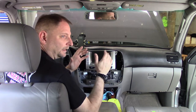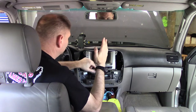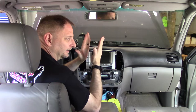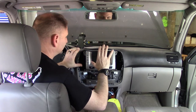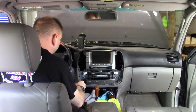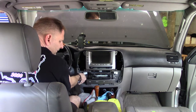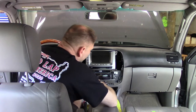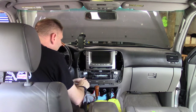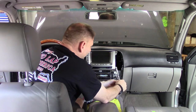You'll bend it if there's too much pressure with the wire harnesses, you'll end up bending these tabs, these ears, these flanges. It won't pull the whole thing in, it'll just bend in. That's why you want to make sure it's as flush as possible before you ever start putting fasteners in. And you just put our fasteners in, they're 10 millimeter. And the torque on these is snug. We'll just go back over these. Make sure they're snug. Gorilla torque's not required, just snug.